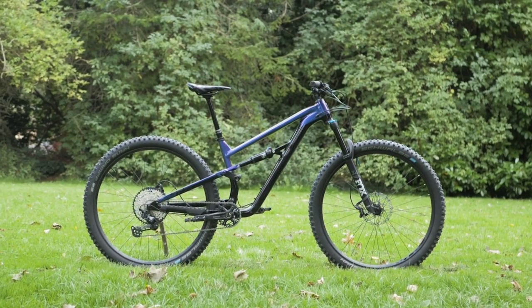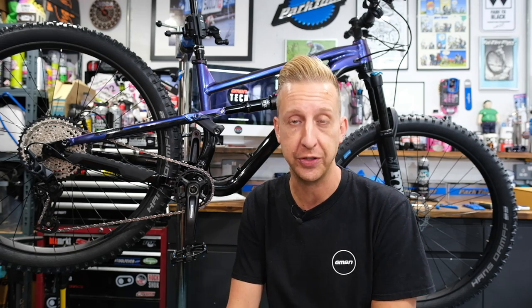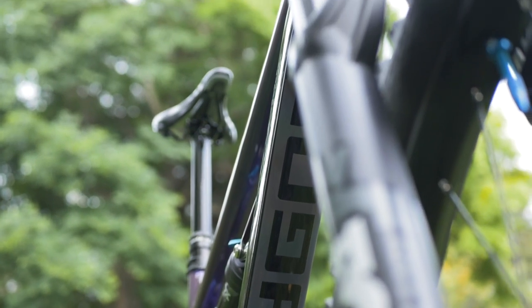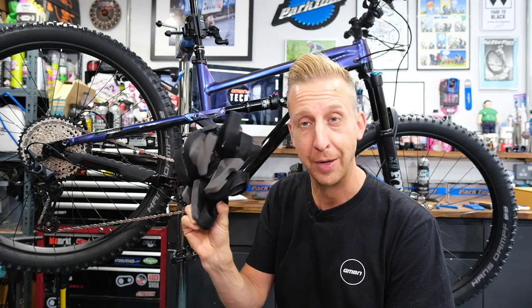You've finished building the bike up and it's finally time for your first ride. A couple of bits of advice before you head out: take some tools with you — at the very least a multi-tool, a pump, and the shock pump you used to set up your suspension, so you can make trail-side adjustments. Also, I always recommend doing your shakedown ride on a familiar trail — something you know well that you can compare your new bike to your previous one, making it easier to identify any setup changes needed. If your bike came in a sturdy box, see if you can reuse it for a trip rather than recycling it straight away. Always recycle everything else and do your bit.